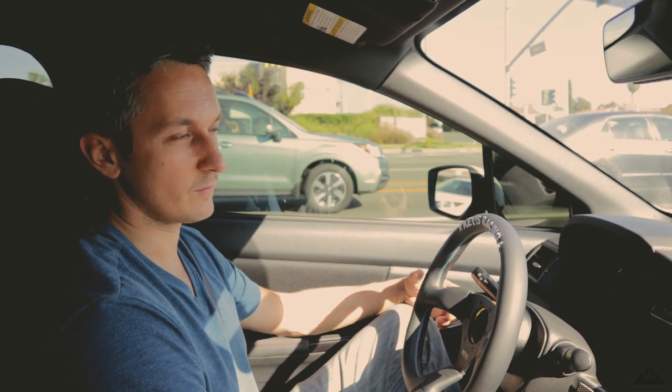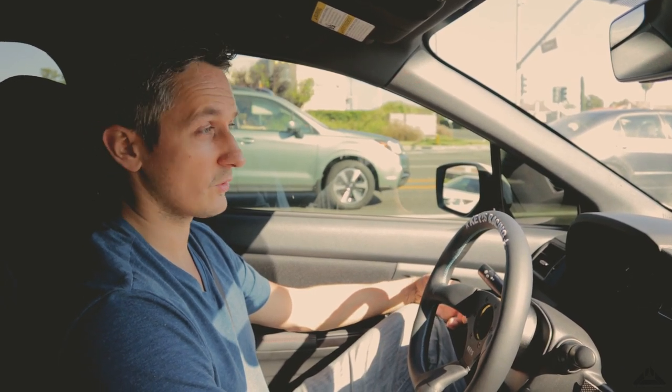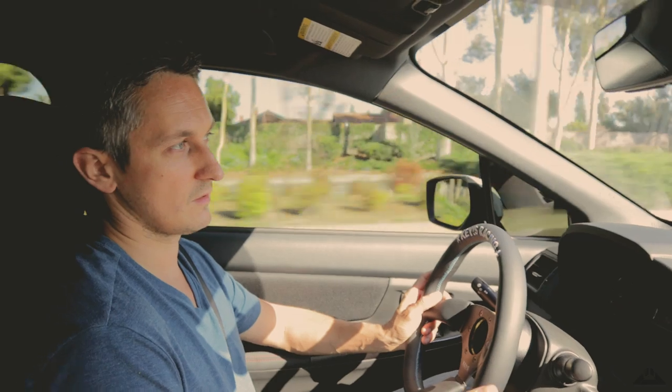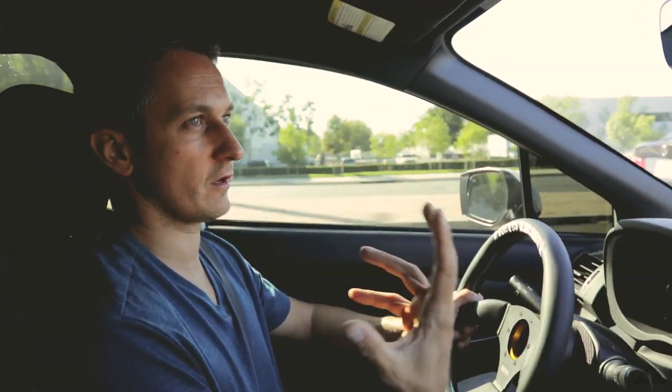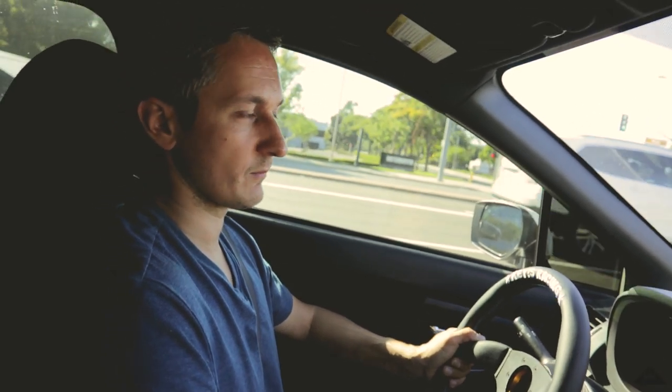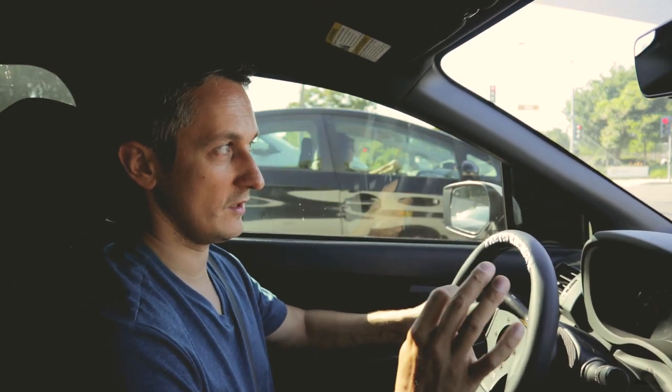Unless you're trying to show off or just having fun, you can do a few shifts here and there. But if you're always doing that, get ready to replace your clutch pretty quickly. The faster you go, the quicker you let it out. If I'm trying to go fast and upshifting, I let out the clutch pedal as quickly as I can. But if I'm not going really fast and near redline, I don't want to dump the clutch too quickly either.